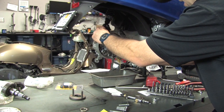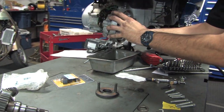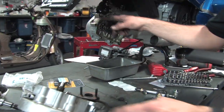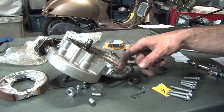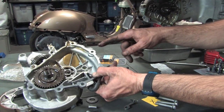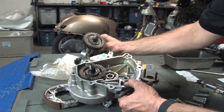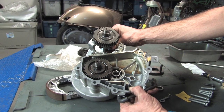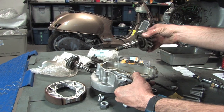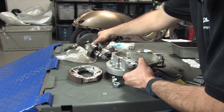We should be able to yank that off now — nice fresh gear oil in there. If it's a little stubborn coming out, you can carefully tap some of these tabs right here. There's a tab here you can tap, and a tab here you can tap. And you can see the diameter difference of the smaller gear — so it's an overdrive gear. Obviously the pinion's a different teeth count too. Give it a little tap, pop that out, set that aside. Pull the intermediate gear out, set that aside.